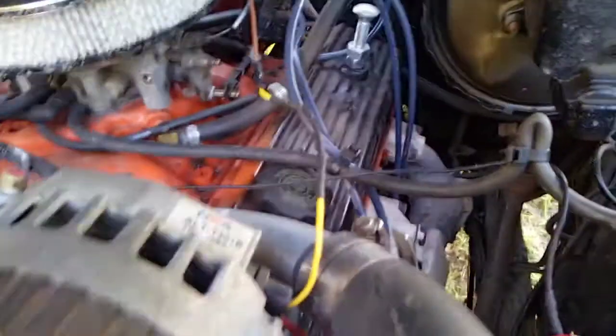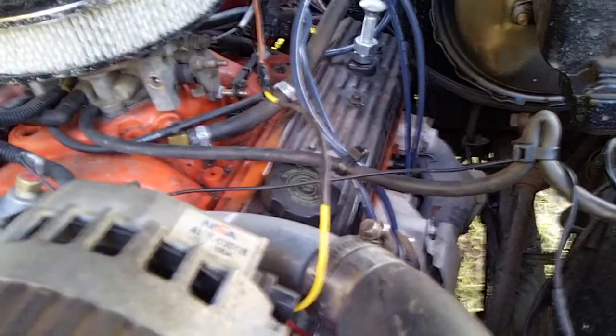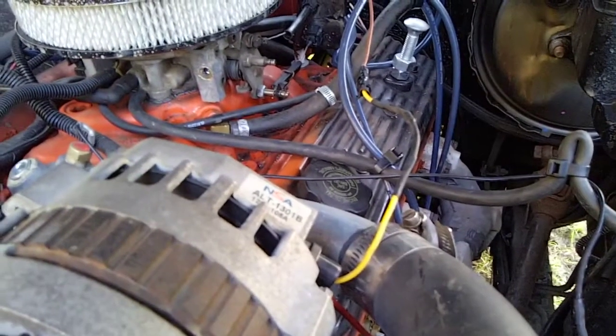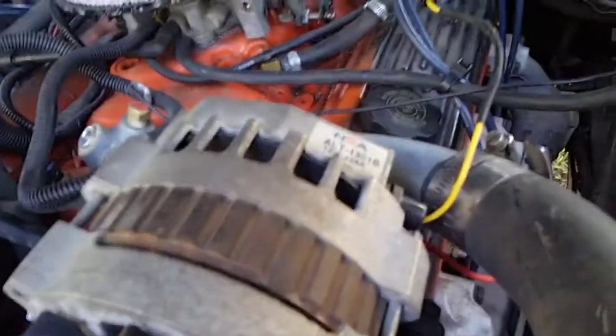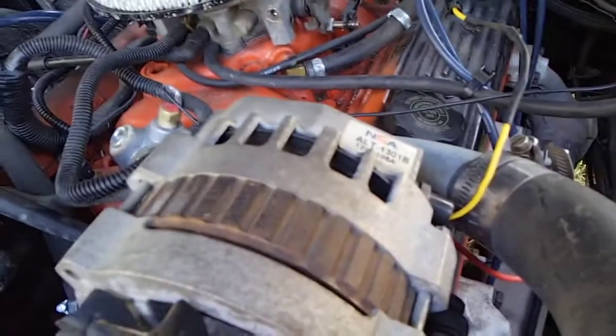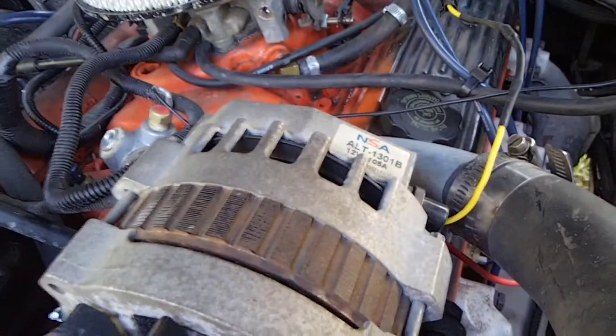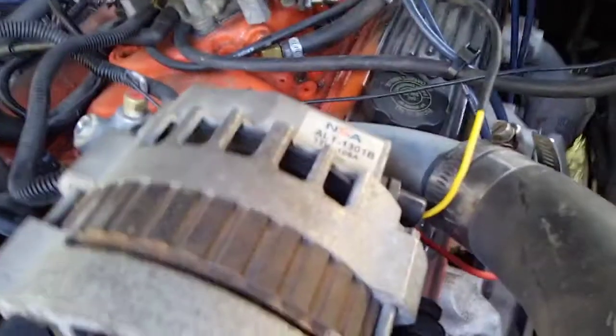You can see this is the third wire on the alternator and it's still not connected to anything. With a three-wire alternator, that unconnected wire goes to an indicator light — I've got a voltmeter in the cab anyway so I don't need that. Then this other wire is an exciter wire; it tells the alternator how much voltage is in the battery and it charges accordingly, so it just needs power from the battery. But what the gentleman failed to understand is that this is about a '95 Chevy small block, and the logic he used for an older GM three-wire alternator doesn't fully apply. When I disconnected this wire from the positive terminal, my draw dropped significantly.